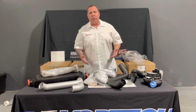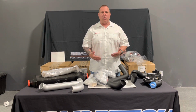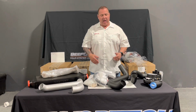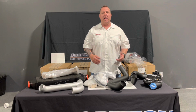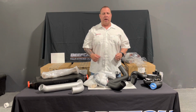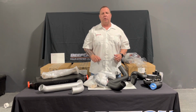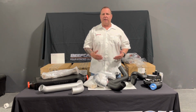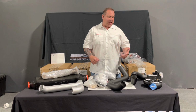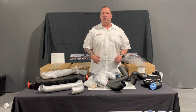On the base boost, just base pump gas, we've been seeing around 600 wheel, which through a big F-150 drivetrain is pretty solid. Obviously, we're going to run a little bit more boost. We'll probably make sure we're seeing at least 10 PSI. We'll probably end up with E85 on it. We've already got some FIC 1440 injectors on our truck in preparation for E85 with the supercharger. We'll probably start it out on pump gas, just so everybody can see what kind of numbers it makes on pump gas. E85 in general on a Coyote, with the additional timing, we normally see about 75 to 100 more wheel.